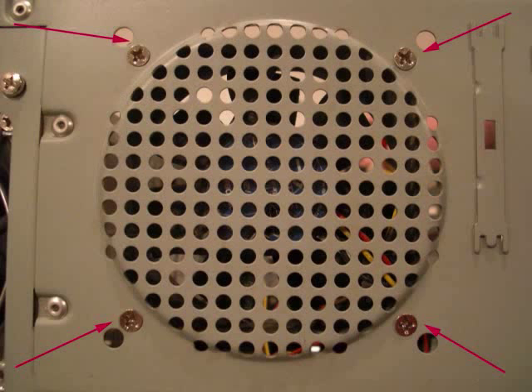As can be seen in this picture, this fan is being held in place with 4 screws. However, some computer case fans are held in by only clips. If you see no visible screws, look for tabs that can be pushed in or out on the fan.